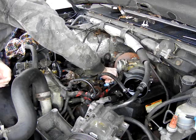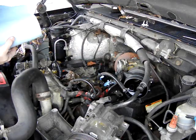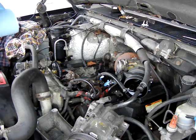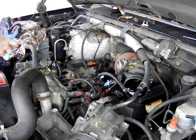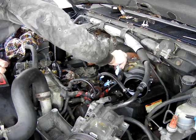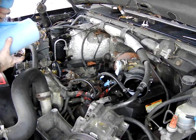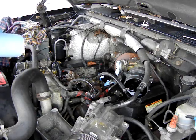I was working on an Isuzu Rodeo and I dropped a screwdriver bit down a spark plug tube because I failed to just take a second to cover up the spark plug tube holes. Because of that, I'll make sure to never neglect to plug up any holes in the engines before I get started on it.